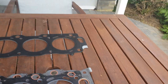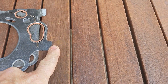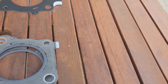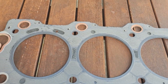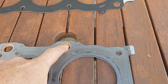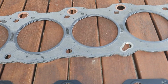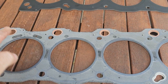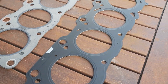We're going to start by looking at the composite gasket. That is your left-hand and that is your right-hand. Laying the gaskets down upon each other — here is where your oil returns to your block, down to your sump from your head. You've got a dowel here and here that hold the gasket in place and hold the head in the right spot. Then you've got your stud holes — ten head bolts, or bolts as I should call them, because standard they are bolts. This engine is going to be getting a steel gasket and upgraded quality bolts, and I've worked with that really well with good results.